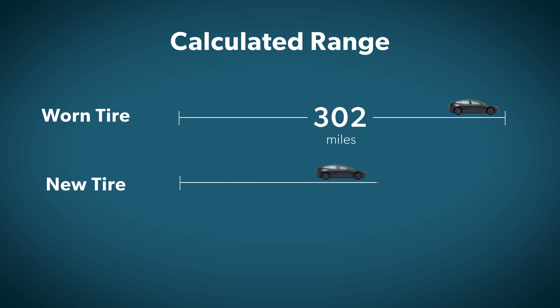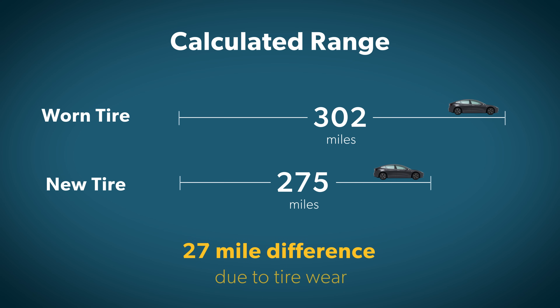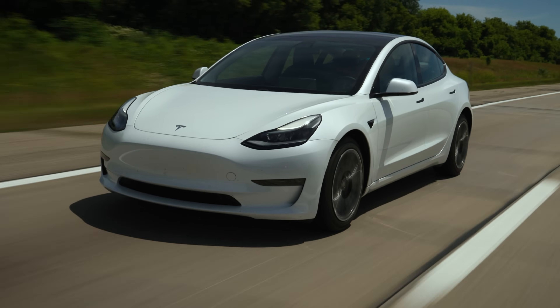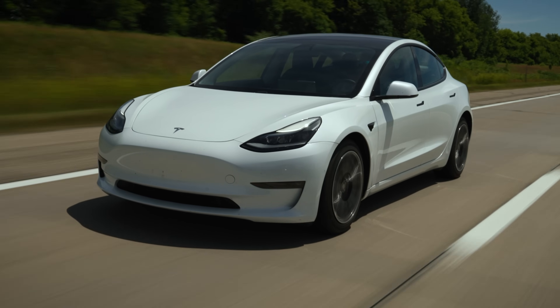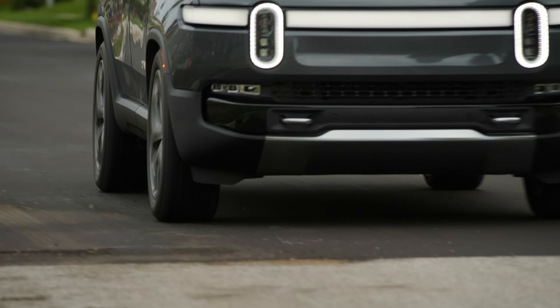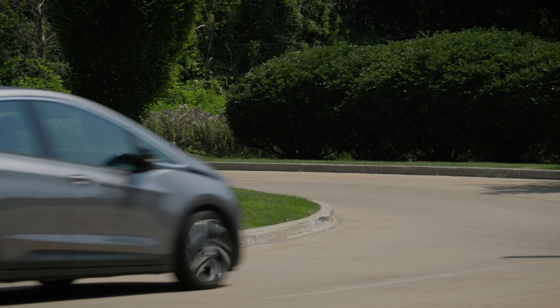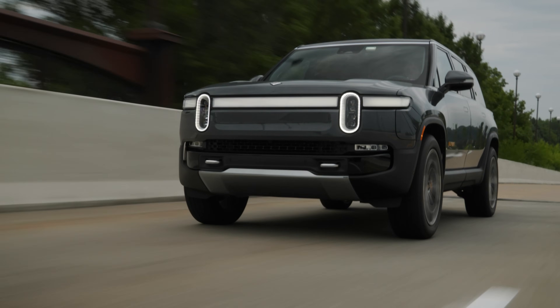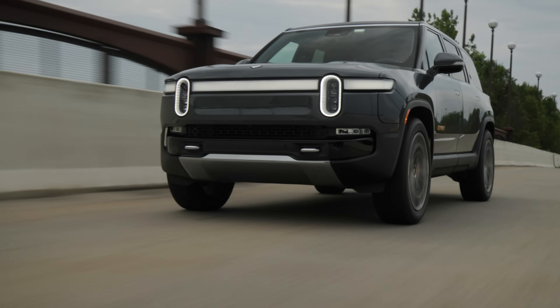So it's not uncommon to see a noticeable drop in range when switching from worn-out tires to brand new ones, even if you replace your existing tires with an identical set. In our testing, we've seen as much as a 27-mile difference in range between a set of tires at the wear bars and a brand new set of the same tires. It's also important to keep in mind these factors are additive — they combine. That means if someone's been driving on worn-out, high-efficiency original equipment tires, and they replace them with a more traction-focused, higher rolling resistance set, they could experience a drop in range of maybe 15 to 20 percent — or possibly even more.